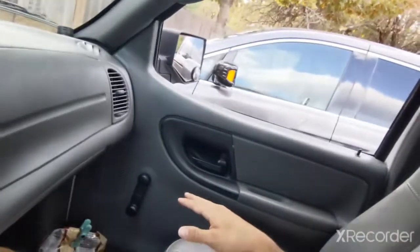That's how you add tweeters to any car — whether it's a truck like mine. I needed sound up front since I've got speakers back behind the seats but couldn't hear up here. This is perfect especially if you're listening to podcasts with the windows down and no AC. Just wire them into your front speakers. If you have an aftermarket stereo it really helps. For about 25 bucks you've got tweeters. You will have to adjust the EQ after because it might be a little too tinny — adjust it to balance your main speakers with the added high-frequency tweeters.